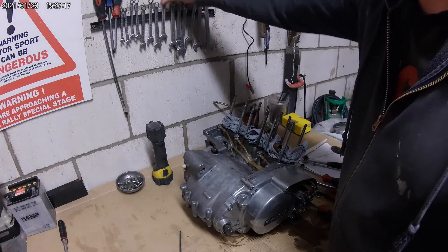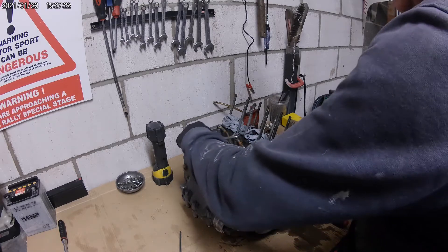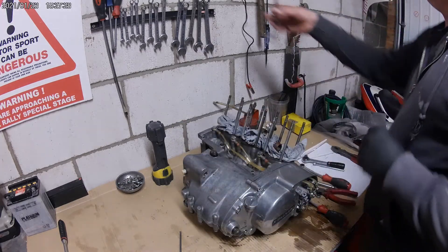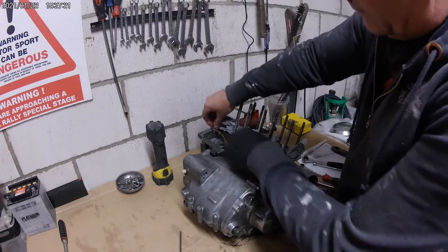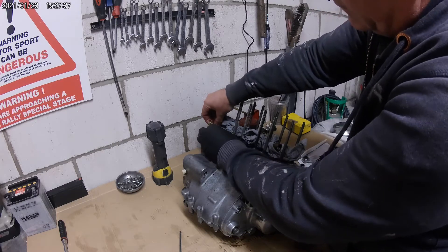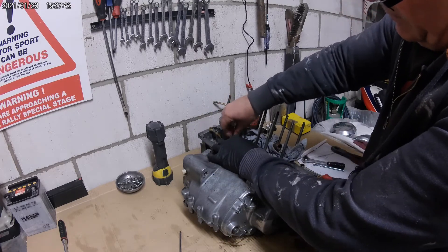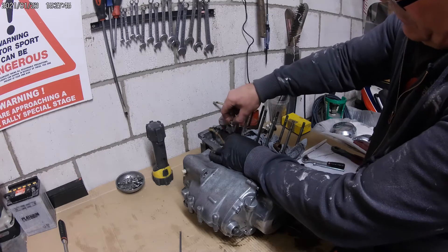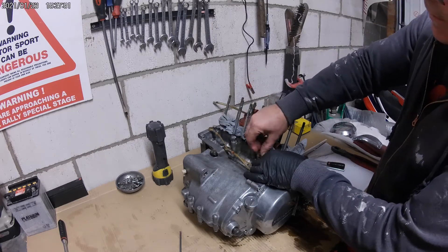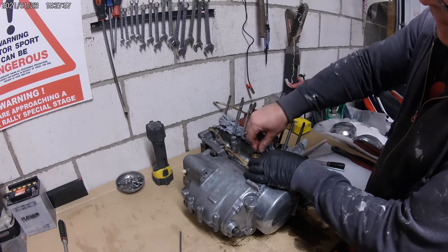Fourteens perhaps. At least they had a degree of torque on them. The thinking is I'm just going to put that back in there for the minute, take that out. It's a sealing washer - I'll just put it straight back in, just remove the banjos off the banjo bolts. And Kawasaki - we've actually got an upper washer and a lower washer on that one.